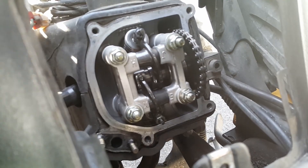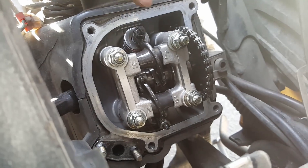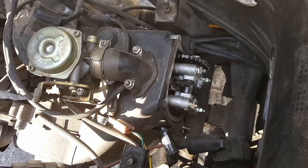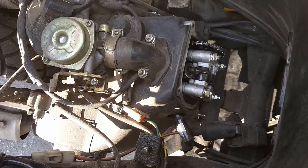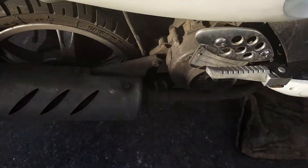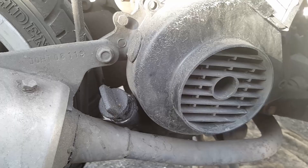And here are our two valves — the intake and the exhaust. Before we adjust them we need to get the piston in the right position. To do that I'll go to the right side of the scooter to the fan wheel cover.